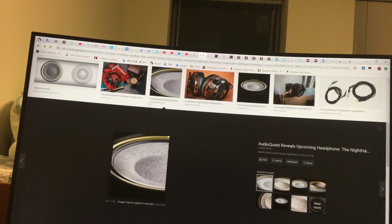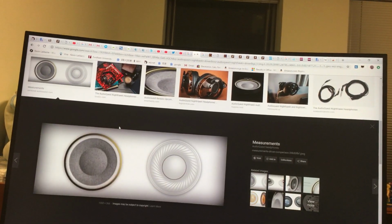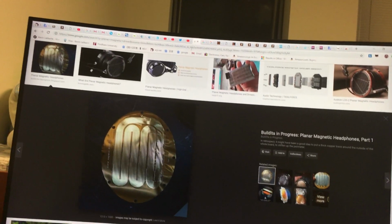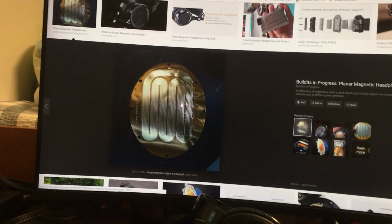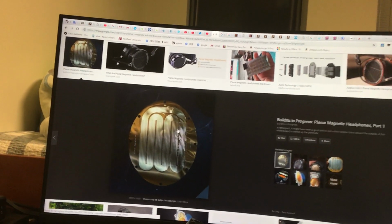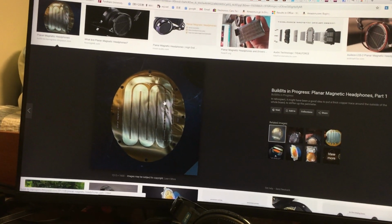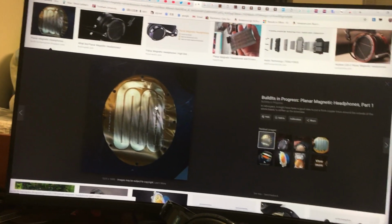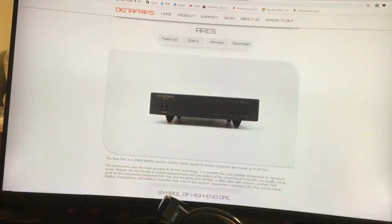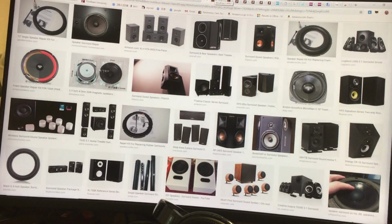And there's no driver tension on a dynamic headphone because it doesn't need to be tensioned. It can travel freely before it reaches Xmax, but on a planar magnetic headphone, a tension is always applied to the thin film right here. So you would hear some planar compression, as people call it, and it won't be as dynamically alive as some dynamic headphone offerings.